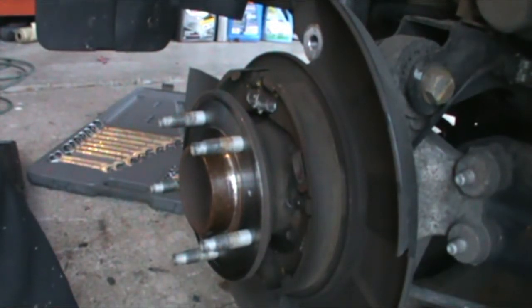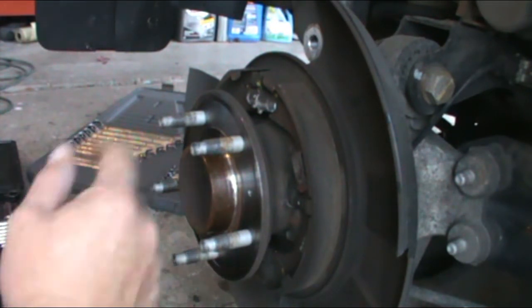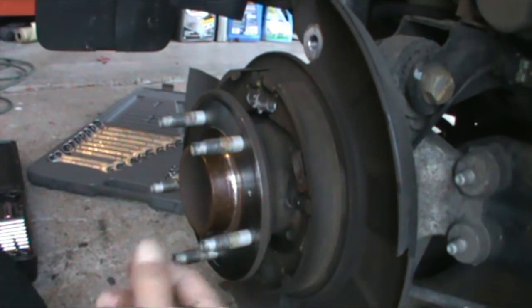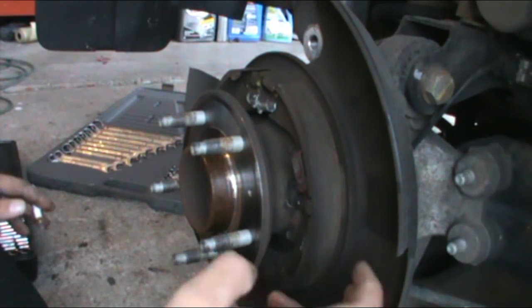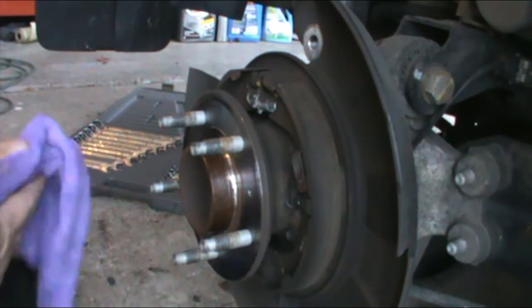I'm really surprised. The reason they're in good shape is most people don't even use them anymore. Even when they park on a hill, they let their transmission hold all the weight and get that massive clunking noise when they put it in gear. You should always use your parking e-brake on any kind of hill to protect your transmission.